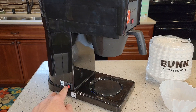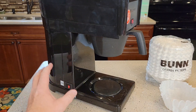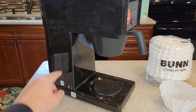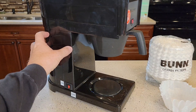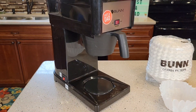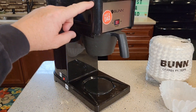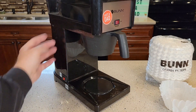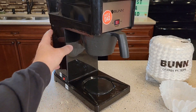Normally this switch needs to stay on. It takes about 15 to 20 minutes to warm that water up when you first get your coffee maker, and there's a setup procedure. You've got to fill that tank up. After it's filled, you turn the switch on and it will maintain that water at a certain temperature, ready to brew at any time. When you first get a Bunn coffee maker, leave this switch off, put water in until water comes out — that means the holding tank is full — then turn it on and it's ready after 15 minutes of warming up.